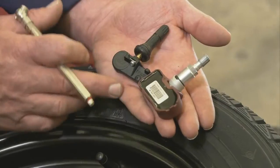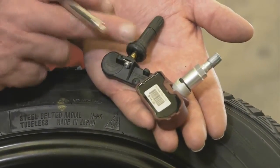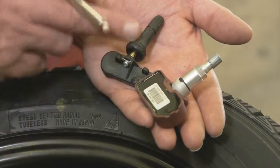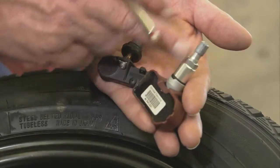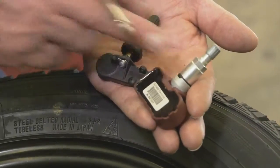There are a couple of different styles and types of TPMS sensors. This one outwardly appears like a normal valve stem, but inside the rim is the TPMS sensor — this is a universal style. This one is the type used by many car manufacturers as original equipment, and it's more visually identifiable, with a rigid stem on the outside and a different color and shape to the stem.